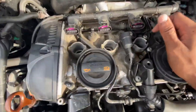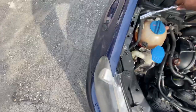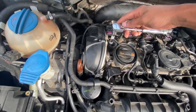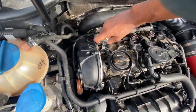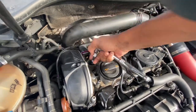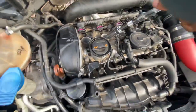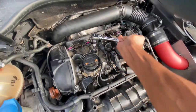You might need a little manpower to get the coils out, unless you use dielectric grease — that's actually used for coils and spark plugs so they come out easier. Now for the spark plugs, I'm going to use a 5/8 socket with an extension so it's easier to reach. That's what you use to take out the spark plugs — pretty simple. I got this one loose, and it's magnetic, so once you unscrew the spark plug it comes right out because the socket connects right to it.